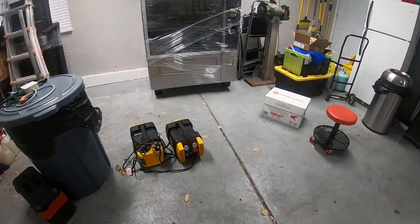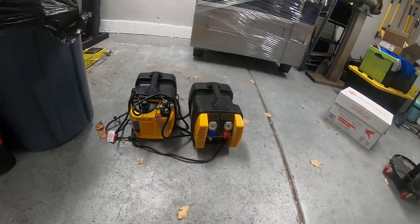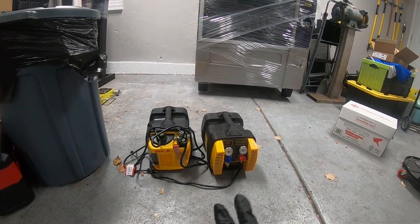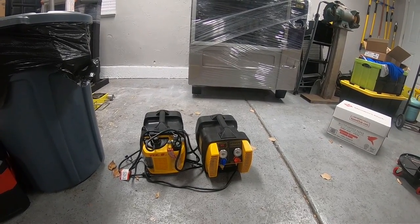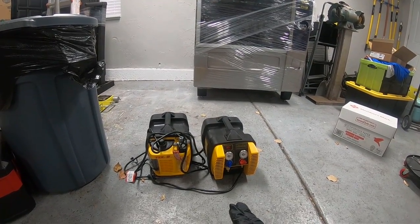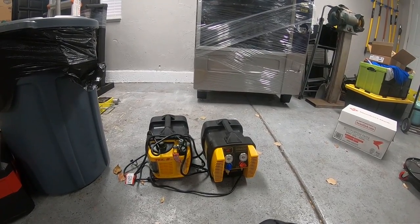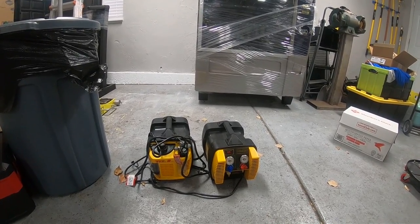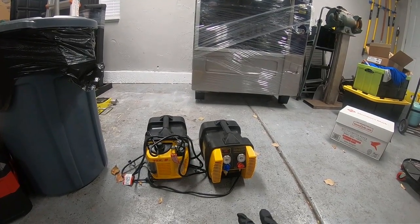We're going to clear this out. While I'm clearing it out, I was looking at these two machines right here — if you do your own vending machine repairs, specifically soda machines, these are a must-have. If you have a freon leak and your machine's not getting cold, you need a recovery machine and a vacuum pump. These are to take the freon out and replace it with R134a. I might make another video on must-have tools, but these are the ones I use for repairs.